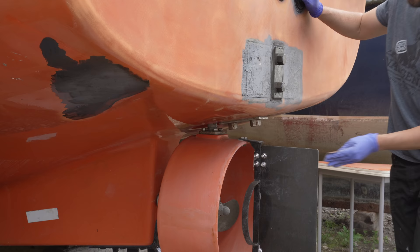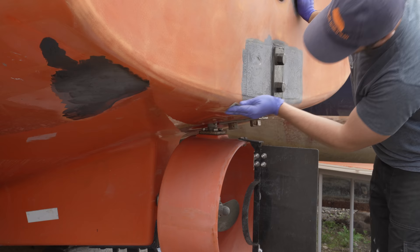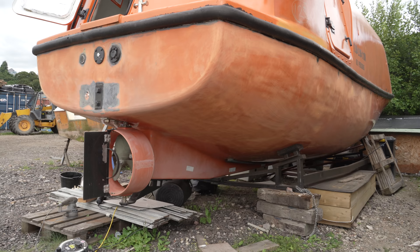You'll notice the fiberglass repair I did in episode 22, previously having sealed it with new epoxy primer as a small test area. I do also find that the sanding discs detach especially fast if the whole pad isn't pressed against the surface, so hand sanding the edges and contours seems less enraging.